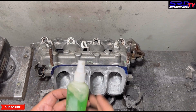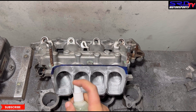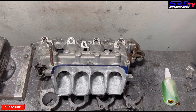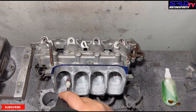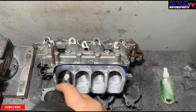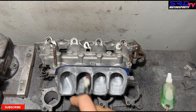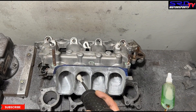Now at the porting bench, we spray our ethyl alcohol and Joy dishwashing soap mix as lubrication, then go in with an 80-grit sanding roll to smooth out all the areas we couldn't previously reach. It gets interesting because you're starting to feel areas that we couldn't smooth before without chopping this section. It's actually quite addicting getting all this smoothed out.